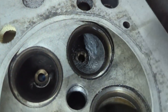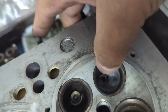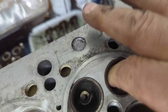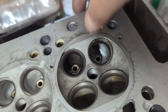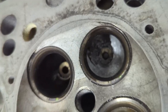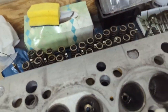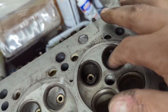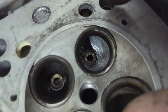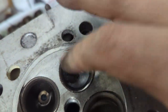This is a very tedious process. I'm trying to focus on the short radius of the port because that's where the airflow will basically go due to flow dynamics — around the shorter radius, not the longer radius. You can see here, just taking off little by little. Maybe the bit I have is too small, but at least this way I have it better under control and won't accidentally hit anything. It'll just take longer. This is basically all I'm going to do — just smooth it out, take some material off, cleaning out the ports.